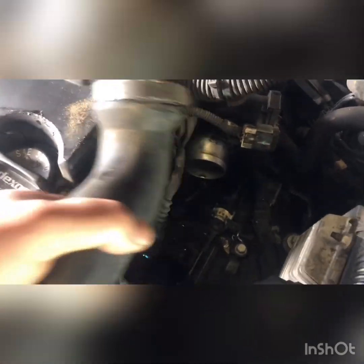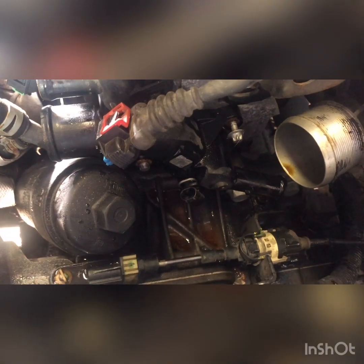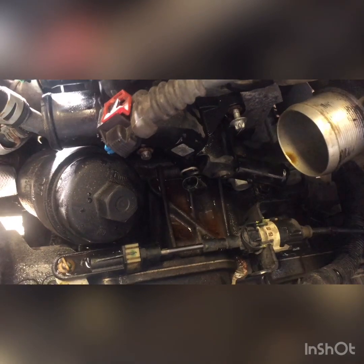What I did to get to this point: get the intake tube that's in your way, pop the sensor off of it and slide it out of the way carefully. Then take your radiator hose and this heater hose off. There's a clip here that comes out — that's the return to the reservoir. There's also a heater hose in the back that pops off, and that gets you down to the water outlet with the sensor. The replacement was like $26 and comes with new seals and sensor — very cheap.